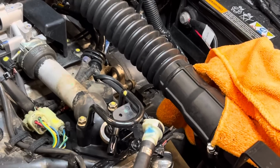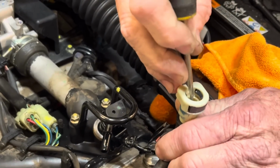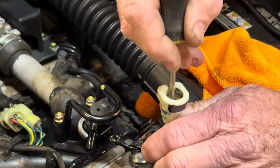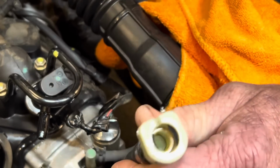And most of the time, if you have a carburetor cart and you smell gas leaking, normally it's the carburetor running rich, and you'll notice you'll smell exhaust. Your exhaust gets worse, or you'll notice that you start burning more gas, or it starts bogging on the bottom end when you take off.